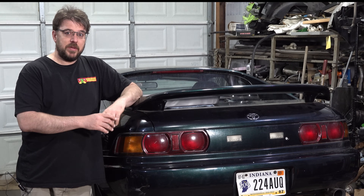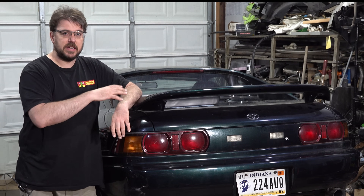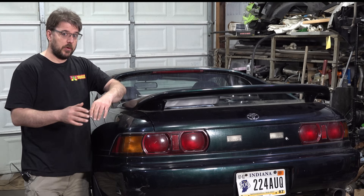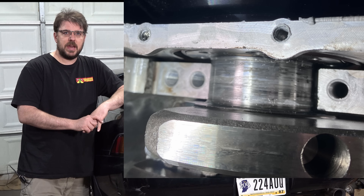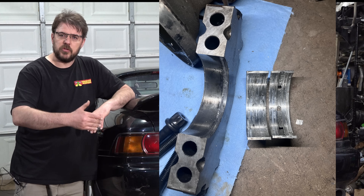As I said in the previous video, this is the same car from that. When I was building this thing I accidentally did a really stupid mistake and started it without putting oil in it. There's reasons and distractions and whatnot, but it doesn't matter. I started without oil and you can see here a couple pictures — it wasn't that bad. It was the number four main that was mostly the damage and then the number six connecting rod. I figured some of the debris from there probably made it into there.